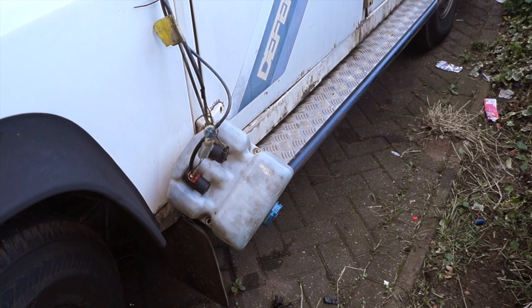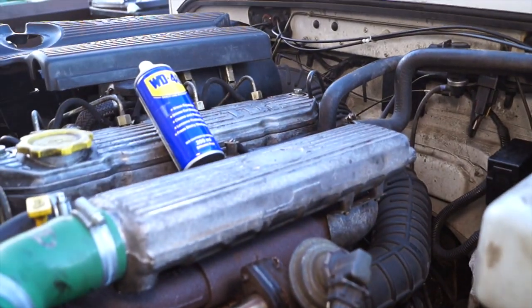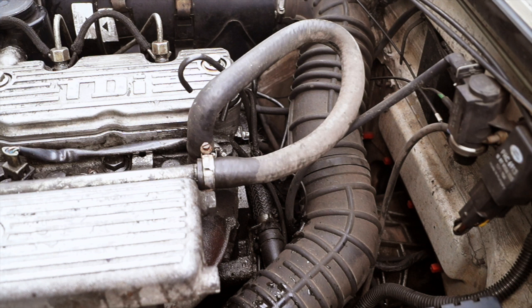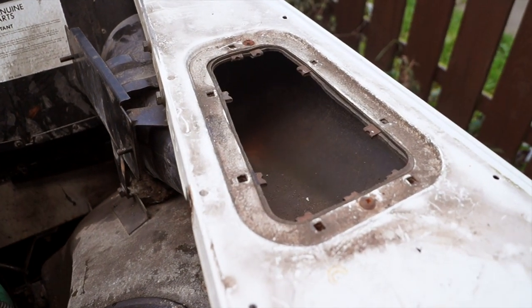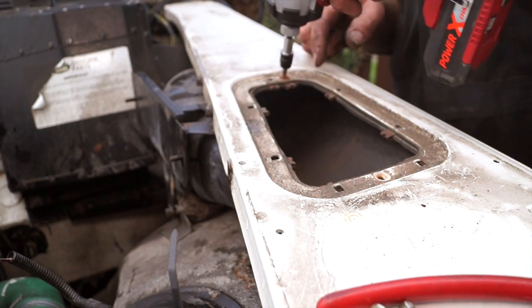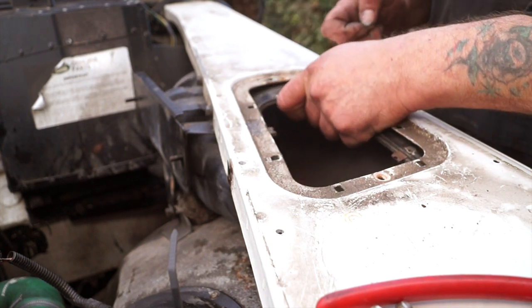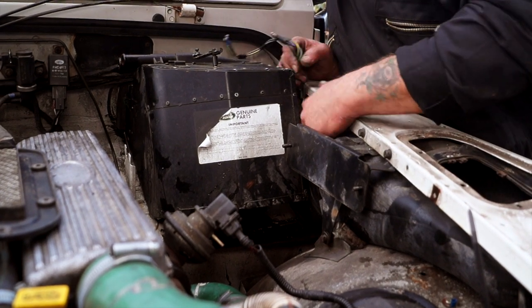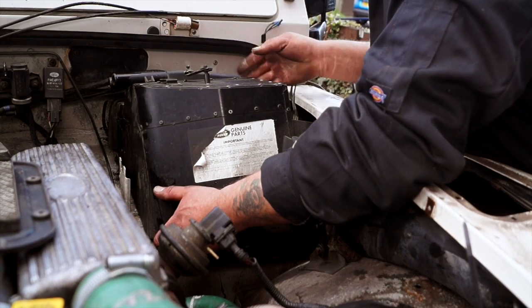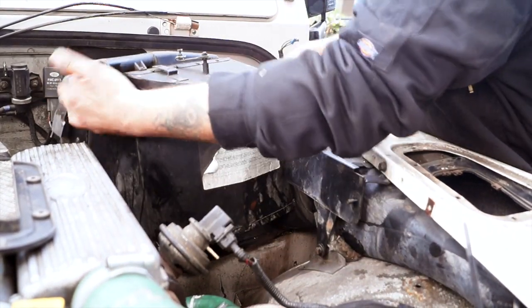There's more to it — you've got to remove a few more things like the washer bottle, which may be in different places on 300 TDI defenders. I've turned the coolant pipes back on themselves, coming out of the engine and back into the engine, bypassing the heater so we can still run without one. You also have to remove this venting duct by taking the screws off and sliding it forward. Once that screw is out and the duct pulled forward, there's enough space to wiggle the heater box out.